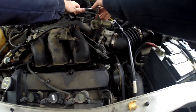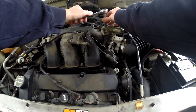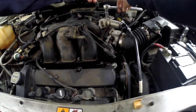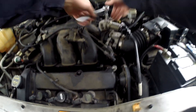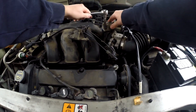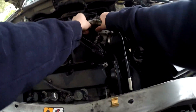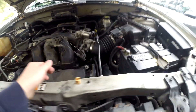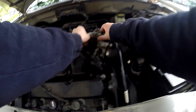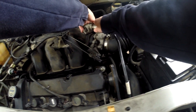This extension is long just because that's the one I found — I bought it to do valve covers; check out that video if you haven't seen it. Basically what happens is this thing gets carbon buildup on it, and that's what I saw when I took it off earlier today. It's not awful but it could help fix my problem, or at least mitigate it, because the PCV valve actually mitigated the majority of the problem — I replaced that. I have a video on that as well.